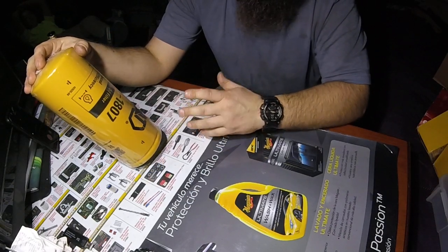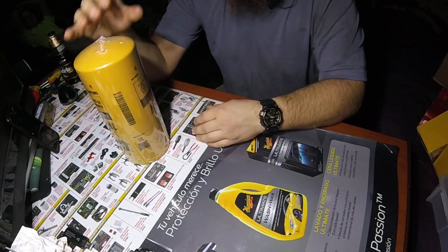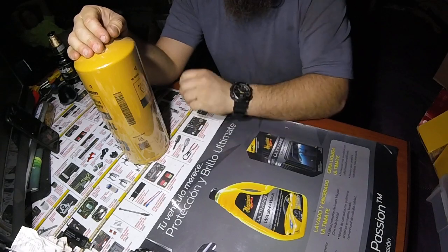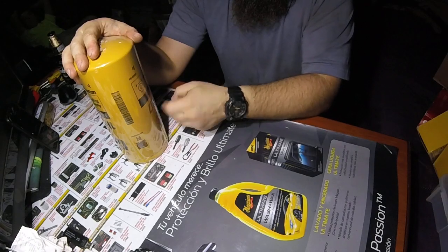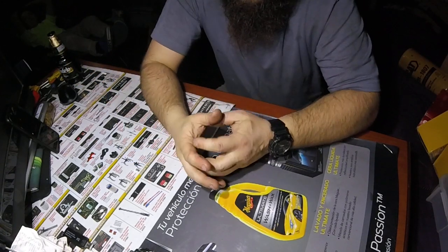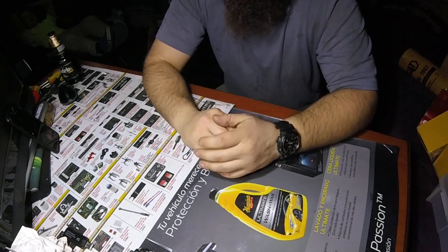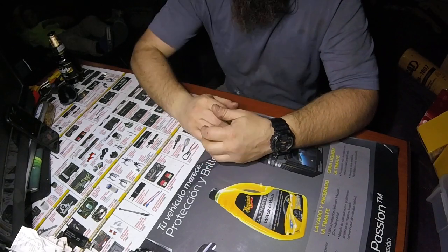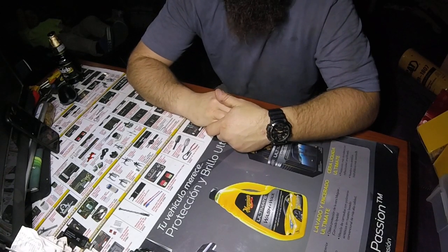So, for the price of the insurance that I'm going to be getting out of it, using synthetic Rotella with the good cold flow numbers of a 5W40, that's going to be really nice in cold starts. Using high quality filtration, and most likely using another centrifuge as a bypass filter, I should get more than reasonable lifespan out of this engine, if not impressive. So, we're at 220,000 miles now with no mechanical issues, so let's keep it that way.